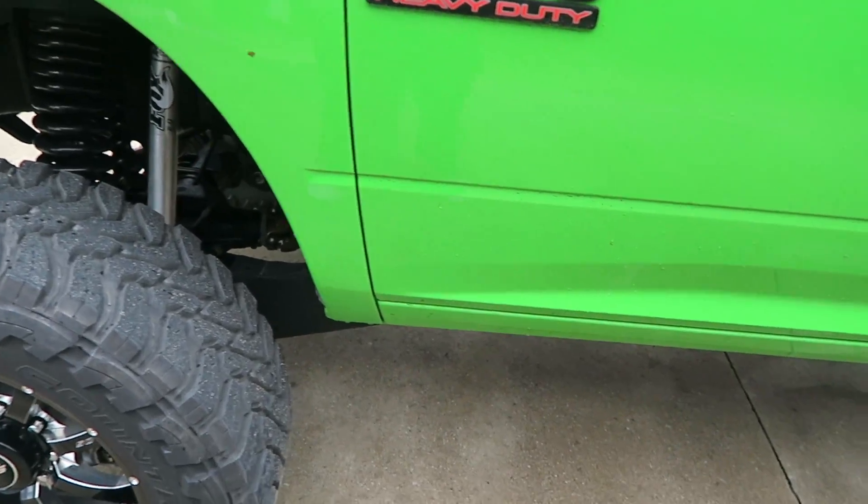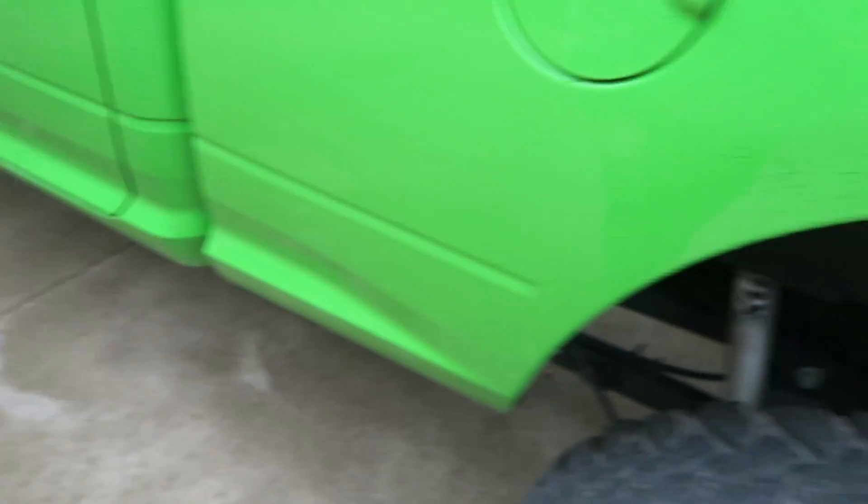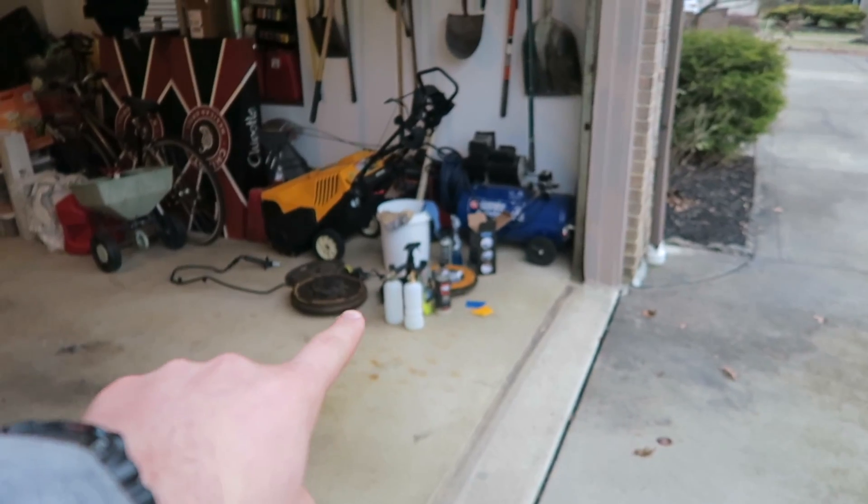Back at home — we drove on a dirty road and the truck is already dirty. So who knows if it'll be nice enough tomorrow to power wash this off. Short story short: yes, you can float gears with a dual disc clutch. I'm really loving this tripod. Do I recommend floating gears? I don't really recommend doing it and I hardly ever do it. Sometimes when I'm driving and trying to buckle up, I'll just float it from third to fourth and it'll be just fine. With a dual disc it makes it a little more difficult, but it is achievable, as you saw.